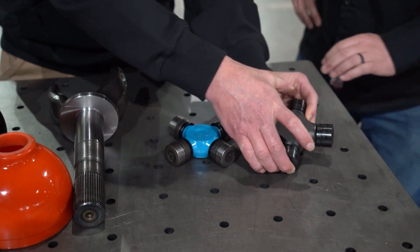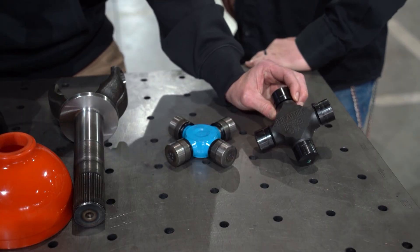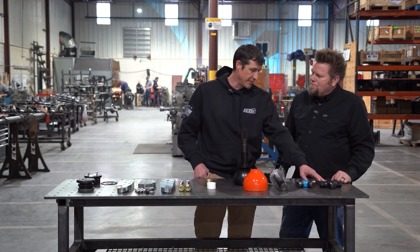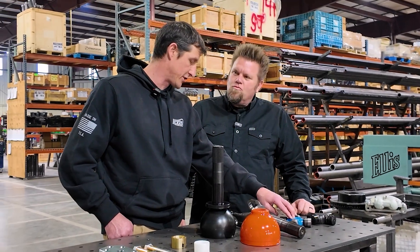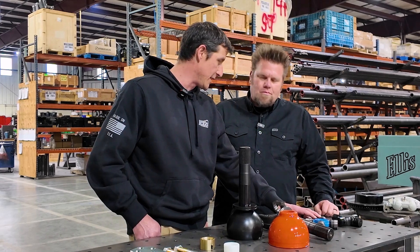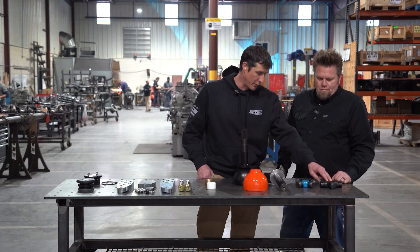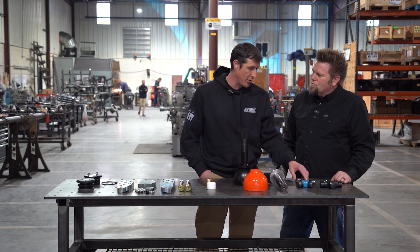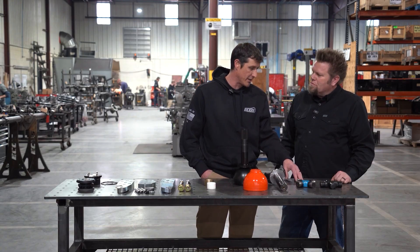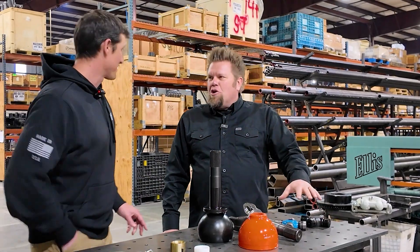Additionally, Brannock has made 300M and 4340 no needle bearing U-joints. These are kind of like the indestructible U-joints. Spicer joints are better for the street because they have needle bearings in them and are used to spinning fast. The Brannock units are for your hardcore buggy guys — nearly indestructible — and Brannock has them in both 300M and 4340. So if you want U-joints, two very good options.